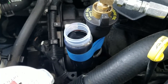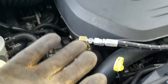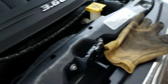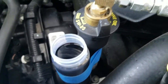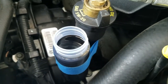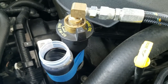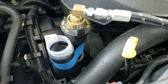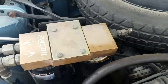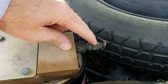We're back. Before I did the process I went and got some gloves to promote safety first. You can see I have successfully filled the sample bottle with oil, pretty close to the top. Now I'll get the lid, put it on tight, shut the car off, and we'll submit the information. I also want to quickly show you a different system — this one happens to be a dual bypass unit, and the way you'd take an oil sample on this one is right here using this petcock.